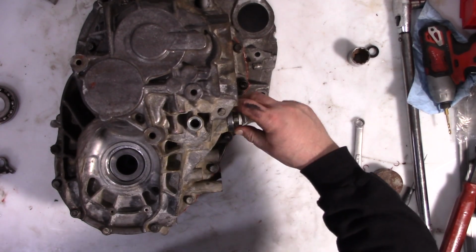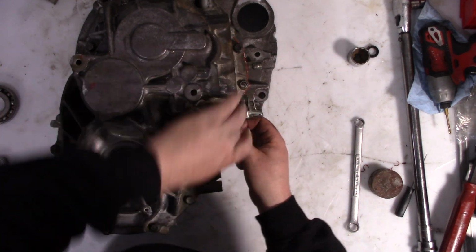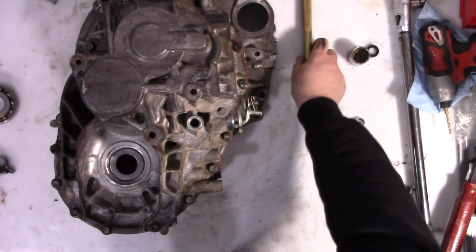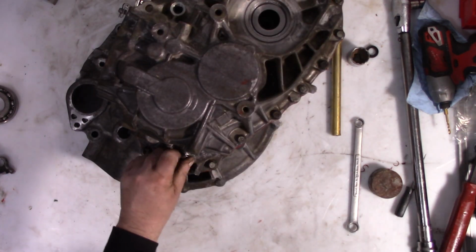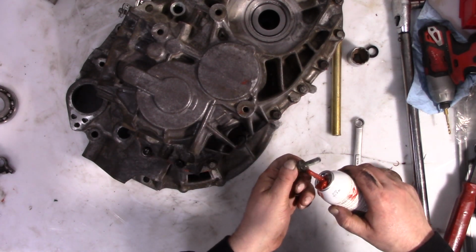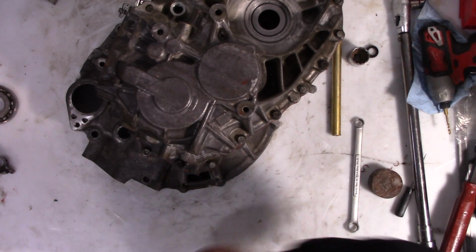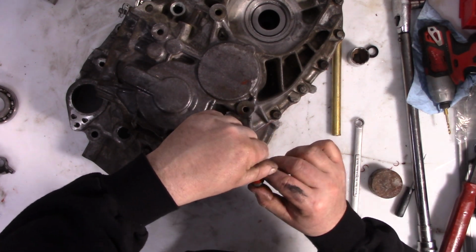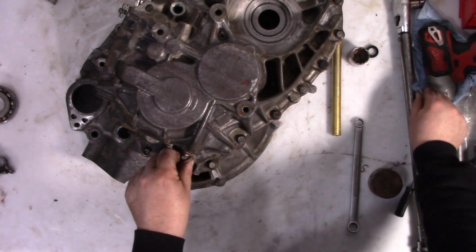Now, we pull this out and put the clip in. Now you take the reverse screw back out. This one's a potential leak path, so you want to put just a little bit of RTV. I'm actually going to go clean this first. Just a little bit of RTV around the base. And again, same 22 foot-pounds.